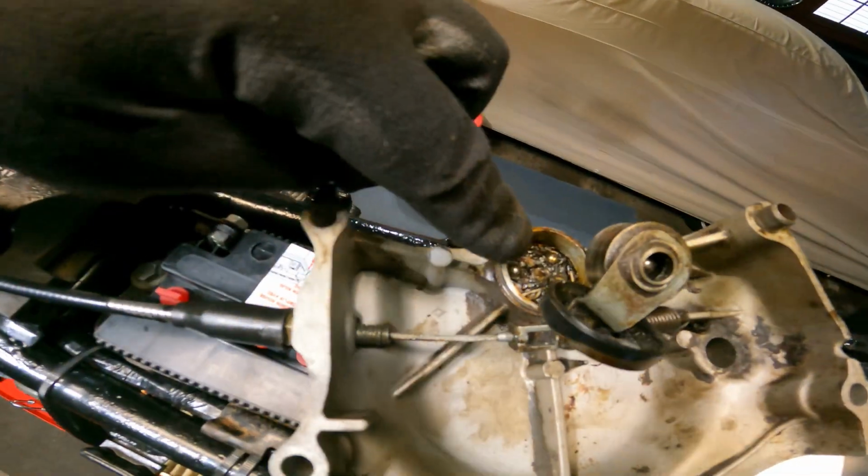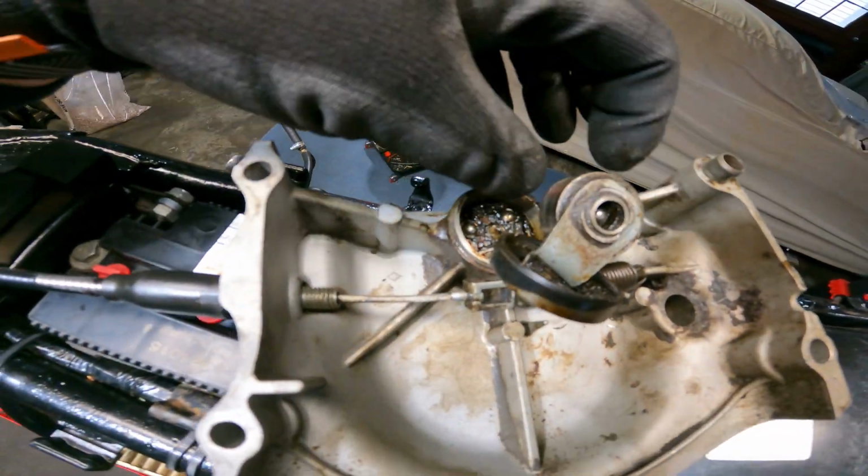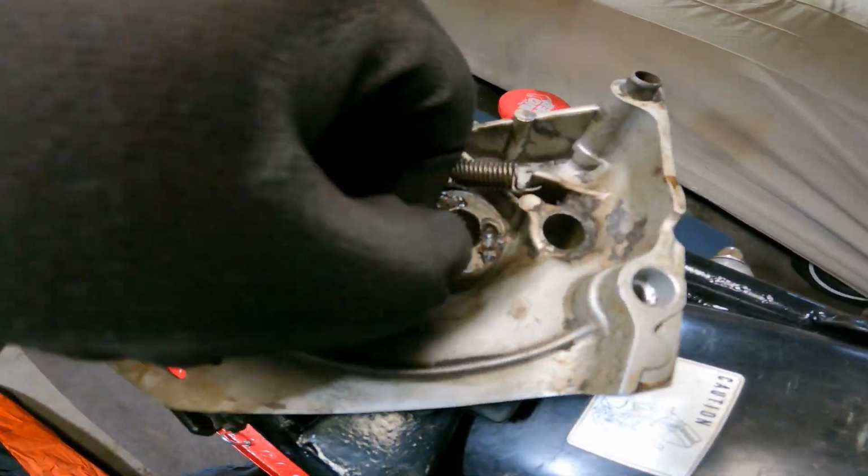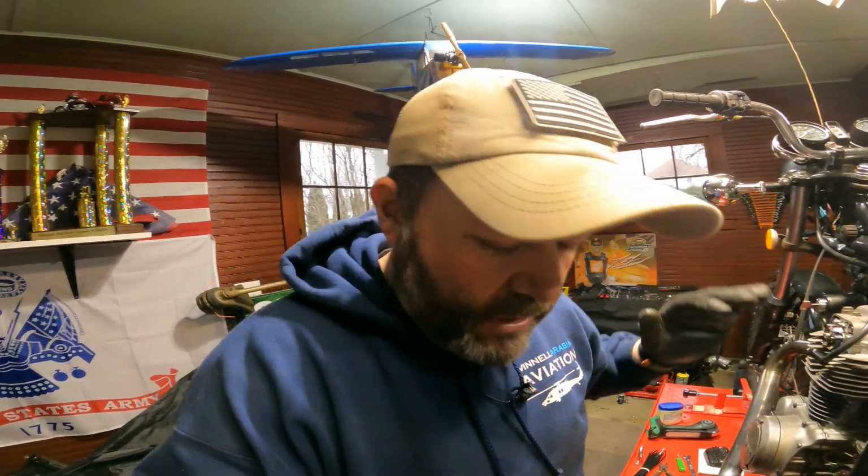When your cables are too tight, not adjusted properly, there's a lot of tension in there and it'll push and be really tight and it'll make those little ball bearings pop to the next, basically just slide over one whole hole, and then you lose your whole clutch. What you got to make sure is there's enough grease in that whole mechanism.